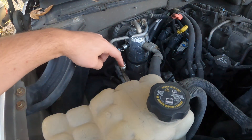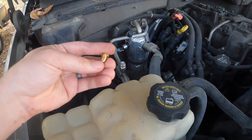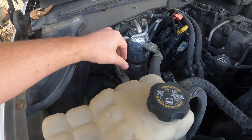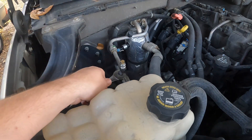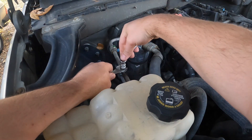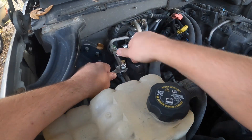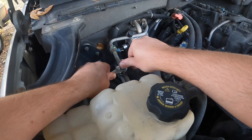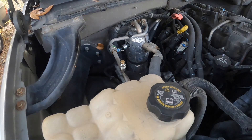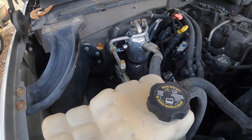It's got a little tapered seat that seals into the service port. I assumed it would have some kind of an O-ring seal, but no — it's a tapered seat. You saw how that port was leaking. We're just going to thread this one in here, hold a little backup, and give it a snug — not super tight, just snug. And let's give it a spray... I see zero leak.